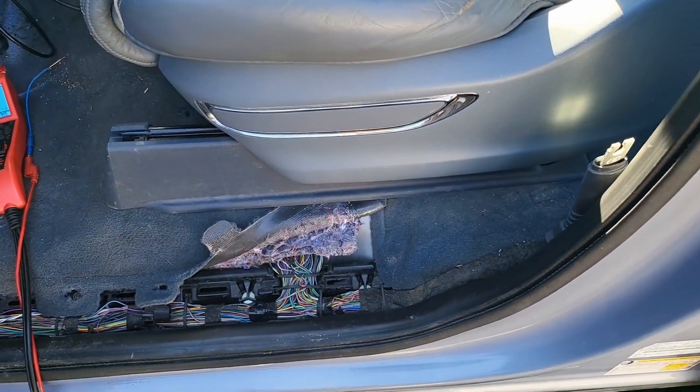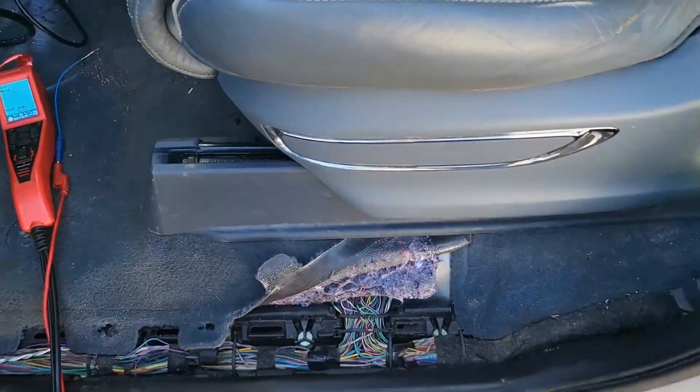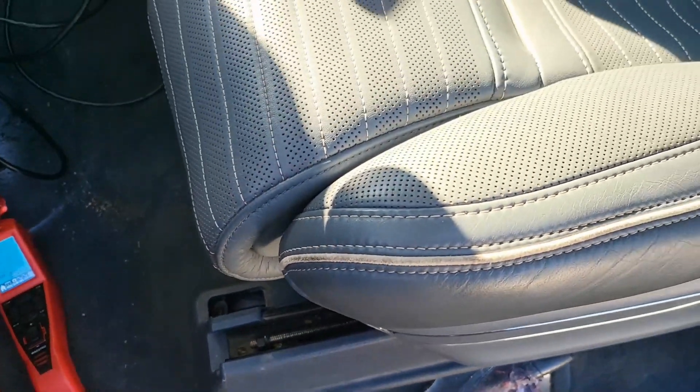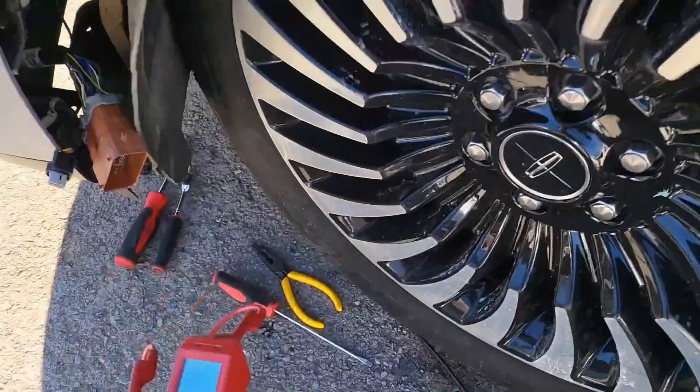All right — repair tools ready, and I'm done. That was our culprit, and I fixed five other damaged wires as well. Discussing this with the owner again, he mentioned door damage. I asked what door damage — I thought he said only the passenger front. He said no, this door was also damaged. So yes, a hundred percent — the door being pushed in is what damaged these wires. That's why it's really important to get the whole story: every small detail helps you connect the dots.